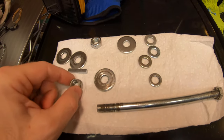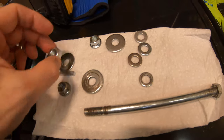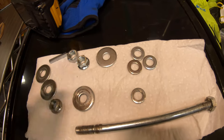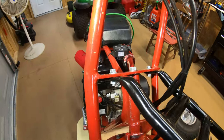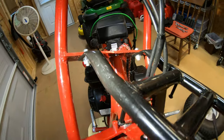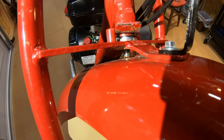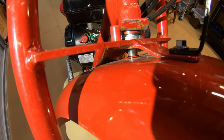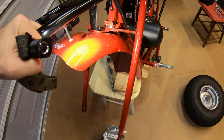The thread pitch is 1.25, so I got a couple extra nuts — maybe use a jam nut. I got a few extra here just to see if maybe I can fix it. Here's what I got going on: I put a small one where it's supposed to go right on top of the head tube bearing, and on the bottom the manual says to put that big one right on the bearing — but that doesn't work because it rubs against the head tube. So I put one of the smaller ones there and put the bigger one underneath it.